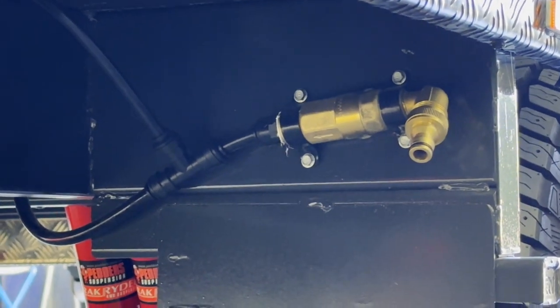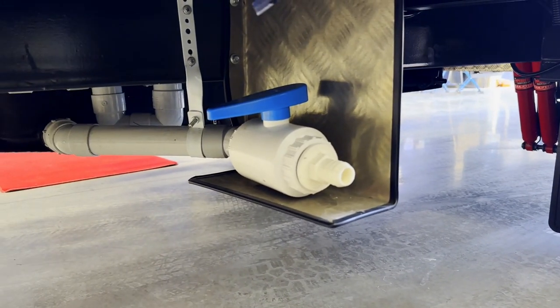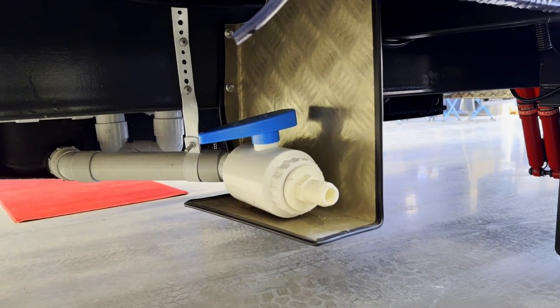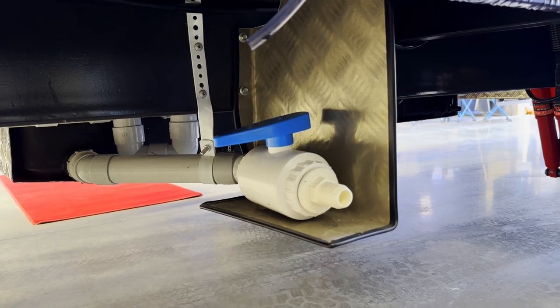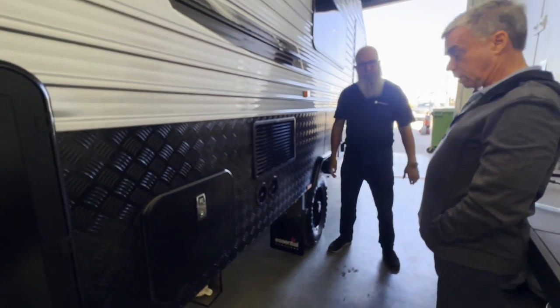Big white tap there. Yep. Is the grey water tank. Yeah. So that's currently in the closed position. The black hose that we've given you just slides onto that barb. Now legally you're supposed to retain it whilst you're driving. I hold mine open for the last bits to come out, because that way there's about 3 litres on the bottom usually. So that sloshes around and gets all the last of that muck out.